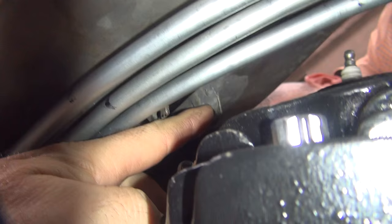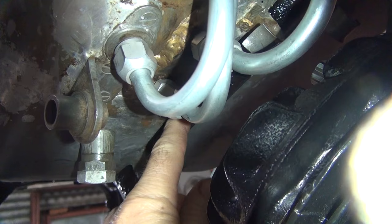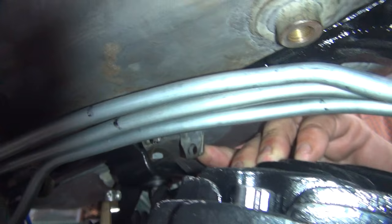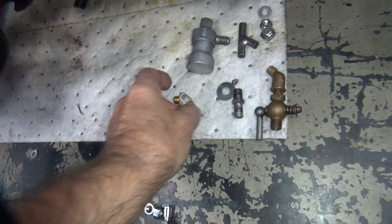There's a spacer in there about an inch and three quarters, maybe two inches. There's another one up here in the front too. I'm going to find something like an old inner tube - we've got to do an inner tube or something around the frame up in here. When it pinches on the rubber between the frame and the tank, that keeps the tanks from going side to side and breaking. If you don't have that, these holes will break or break down the whole slot. You've got to make sure you do that so it doesn't vibrate.